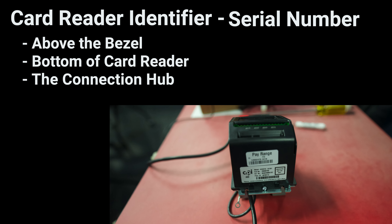Removing existing old telemeter and bezel from Note validator. One, turn off power to the vending machine. Two, use the nut driver to unscrew the four hex nuts for the Note validator's mounting posts and remove the Note validator. Keep nuts for reassembly. Three, disconnect the Note validator's cabling. Four, disconnect all connections to the telemeter.